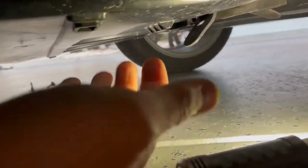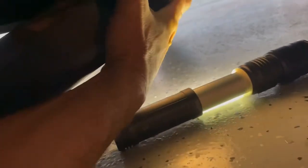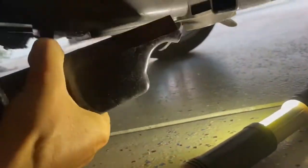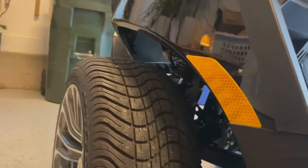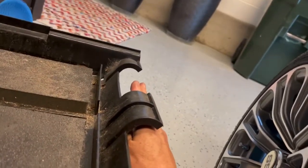I've got basically three of the bolts out, with one end just kind of holding the panel on. The back side of this plastic panel is held in by this pole rod going across — it's kind of curved up and around. So I'm going to take the last bolt out and the whole panel is going to drop down. Just kind of lift the panel up a little bit, push the muffler up through there, and it's out. Here's how this panel is constructed — it's got this little lip down here that kind of sits on that rod going across, and it kind of acts like a hinge.